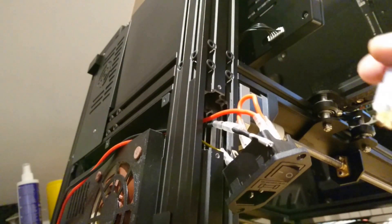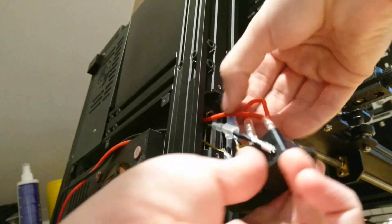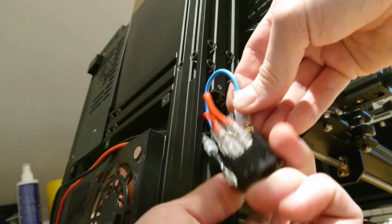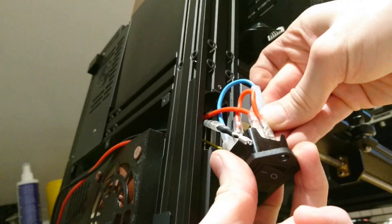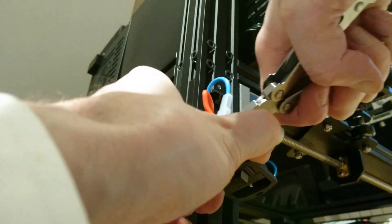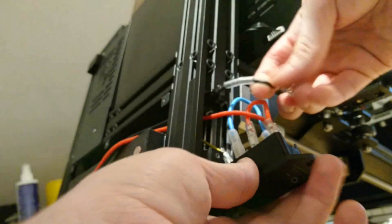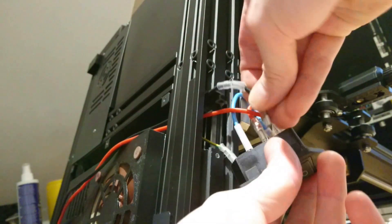We have our new wire, and that will plug onto the neutral entrance. Make sure it's all the way down, and then make sure the boot is all the way down. This boot is the same idea as the existing ones, it's just a bit more rigid — I prefer those. Then it will plug in next to where the live switch plugs into the switch, and the plastic can get in the way a bit when you're doing this. That's all the way on, and then we put the boot on. Now the other end of the neutral has to be plugged into the switch on this side here, and this should be a bit tighter now because I tweaked the connections.